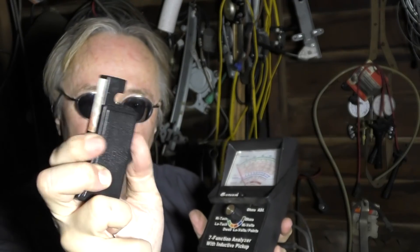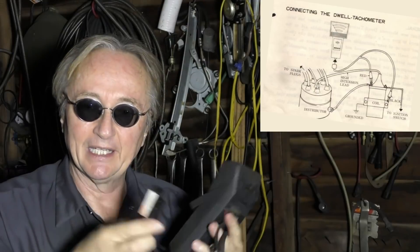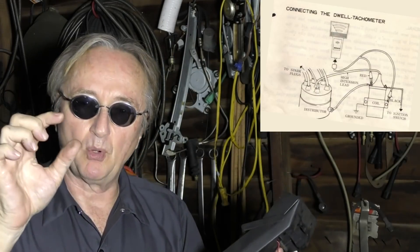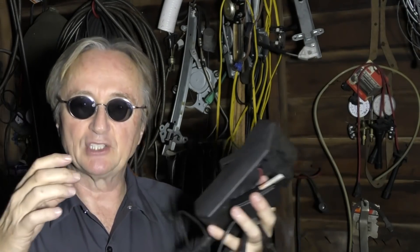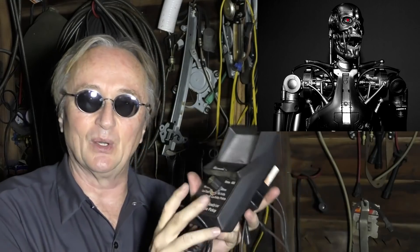This thing — unless you've got yourself a '62 Ford — you're never gonna need to use. It also did ignition timing, because when you set points, a lot of times the end is a little bit different shape than the original one, so that would affect the ignition timing and you'd have to retime the engine by adjusting the distributor. Well, cars don't have distributors anymore. The computer does all that stuff, so this is definitely a blast from the past.